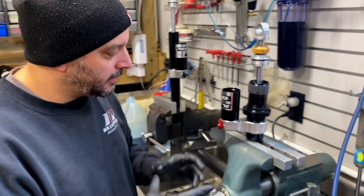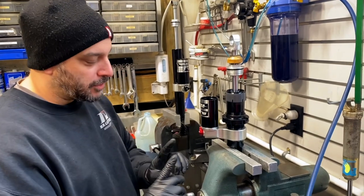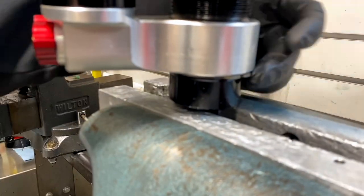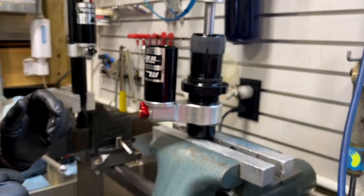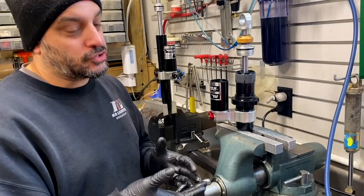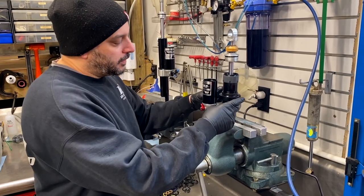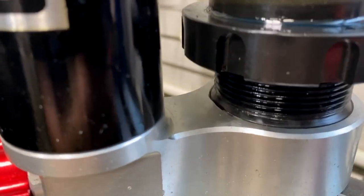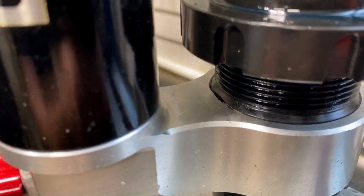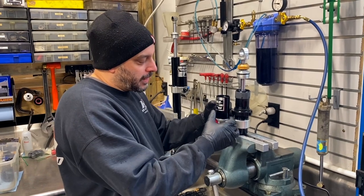High Gear Suspension of Ithaca makes a two-piece round adapter — a lock collar — that goes around the snap ring. It has four allen-pointed set screws that bite into the body underneath and keeps this from happening. It's a very nice upgrade, I believe it's $40 retail. You don't need to disassemble the shock to do it, but you do need to take the shock out of the machine. Make sure the clocking is correct — there's a flat surface inside that you align in relationship to the body and reservoir housing. If it's not right, you can use a rubber mallet gently to get it back into the correct location, then put the lock collar on.